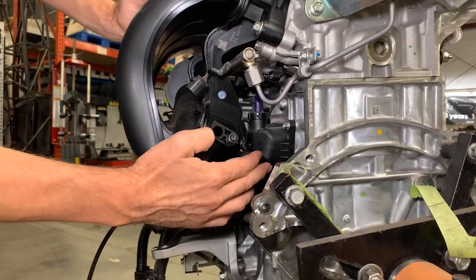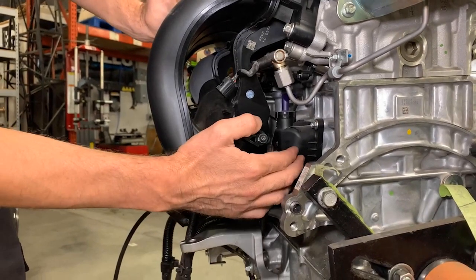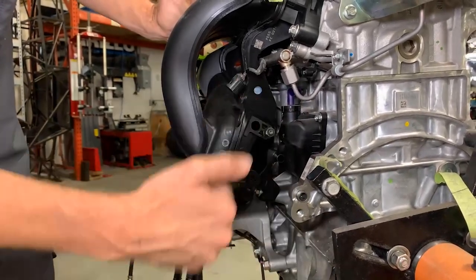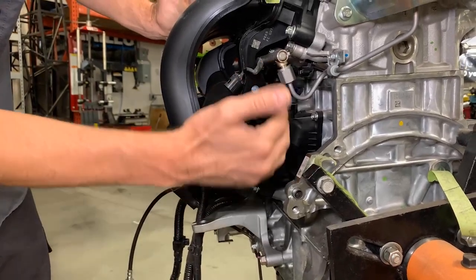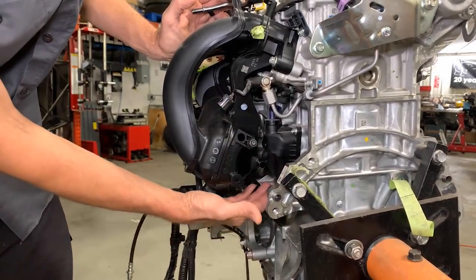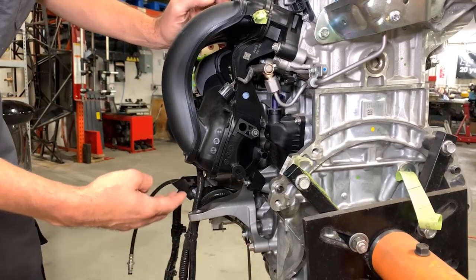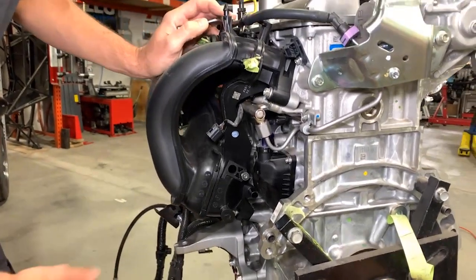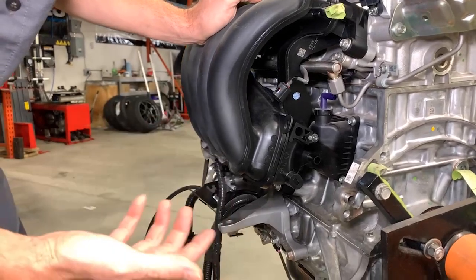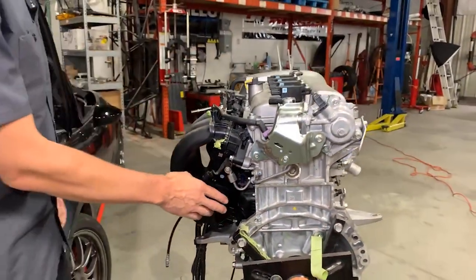On the NCs and NDs, they do actually have a pretty slick baffling setup. However, it is not a catch can. It's going to help the oil come out of suspension because there are channels in there, but it does not have any kind of mesh. So it's not going to be as comprehensive as either one of our setups. And there's no drain — it just drains right back to the oil pan. The OEs do that for ease of maintenance so the driver doesn't have to worry about it. But for those of us who are okay investing a tiny amount more time in maintenance in exchange for the long-term health of our engine, it's a really good idea.